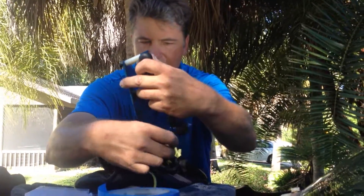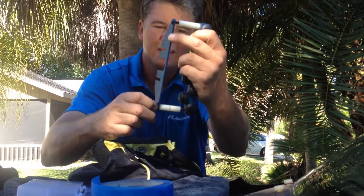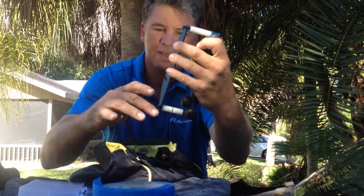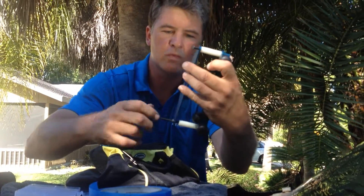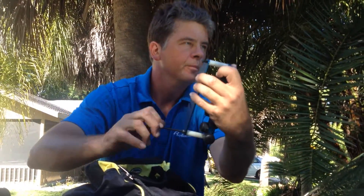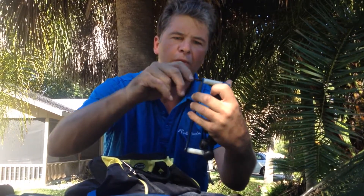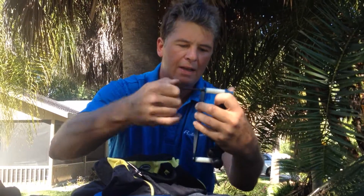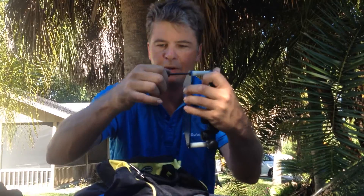Some of you might be saying, well, that seems like a lot to have to do — I can just wing it up there. Well, think about all the damage that you're doing to your back every time you just wing it up there, especially something this tall. And think about what if you're a half-inch off, or you roll that bead, or you don't get it placed correctly and you end up with a wind noise. How much does a callback cost you if you have to drive 20 minutes, burn the fuel, spend an extra 30, 45 minutes or an hour correcting something that could have been done correctly the first time?